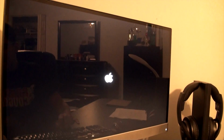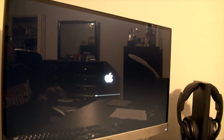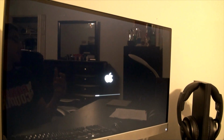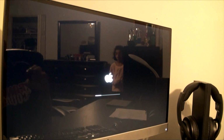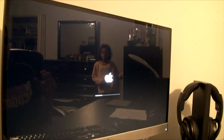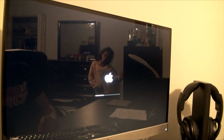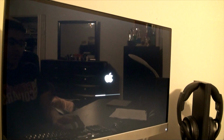By the way, if you get any boot errors or you see the screen turns off or something weird happens, just look online what that error is, and there's usually a guaranteed fix for it. Usually it's in the form of a boot flag, which you can easily access by hitting the space bar before pressing enter, and it'll show you some available boot flags.